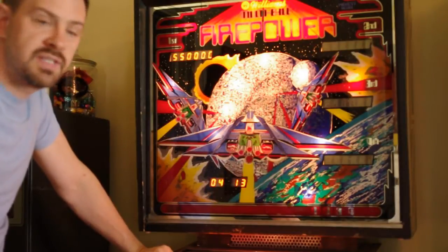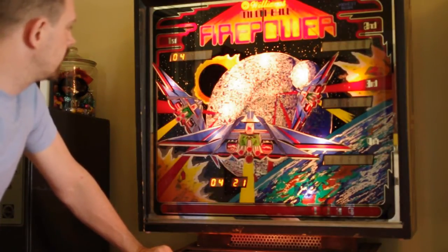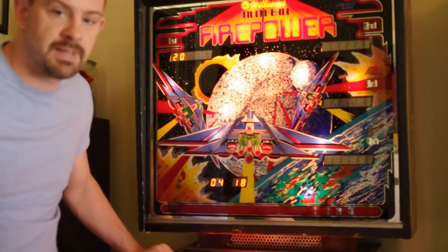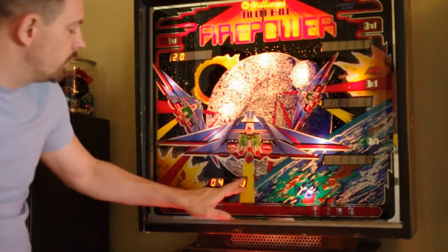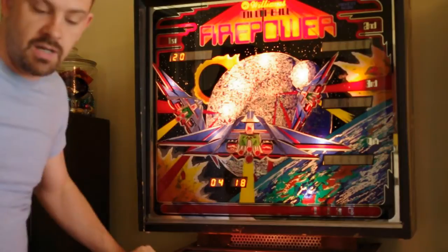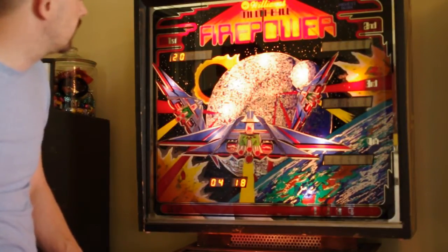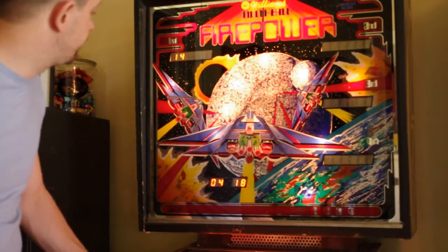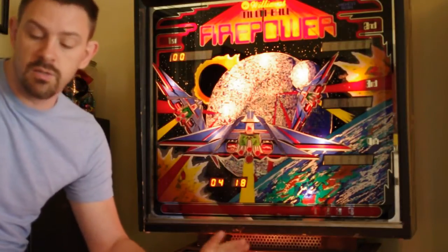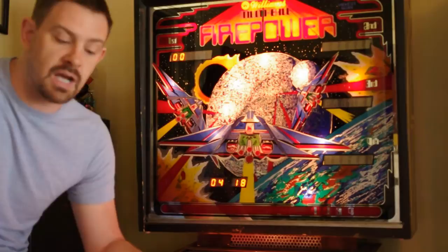Around number 12 is the current high score. On Firepower, number 13 is the score you need for an extra game. The important part to remember is how to get into free play — some games it's number 30, some games it's number 18. In the manual it's listed as 'maximum number of credits,' meaning you can have up to 20 credits put into the game. This is adjustable: hit your credit button or start button and you'll see it go up or down depending on what position your auto up / manual down switch is in. To put your game into free play, set that to zero. What that does is it ignores the credit switches, so even if you put coins in the number of credits will never go up, and if you play a game the number of credits never goes down. You also never hear the credit knocker. It does vary from game to game, so make sure to check your manual.